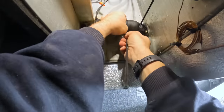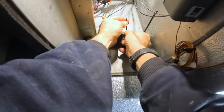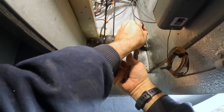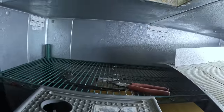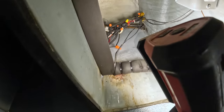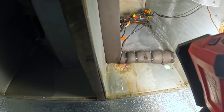Usually three-quarter inch thick is what we use on freezers for suction lines and stuff like that. I would have never guessed in a million years that they would have just put a flare fitting in there and nothing else to hold it — that's just ignoramus, but nothing surprises me anymore. Foam, cheap — $182.30. We've got one last single piece here with an extra wire tie, and we ran a piece all the way across the bottom. The suction lines are not insulated — I don't know how big a deal that is. Shouldn't be a big deal, hopefully. I never noticed anything leaking off of it.